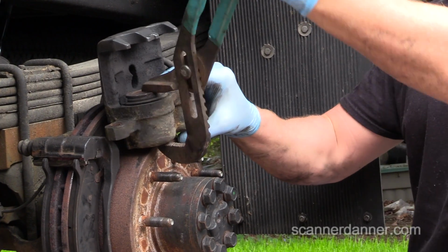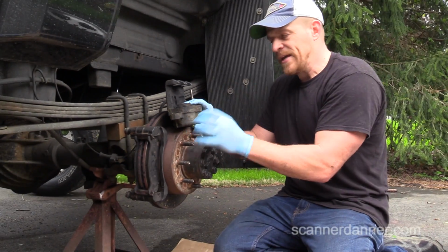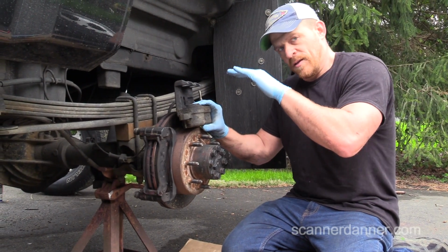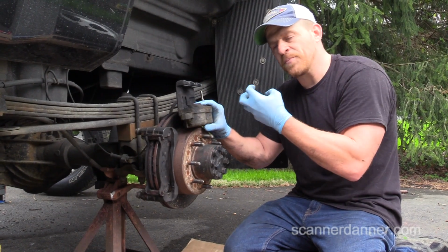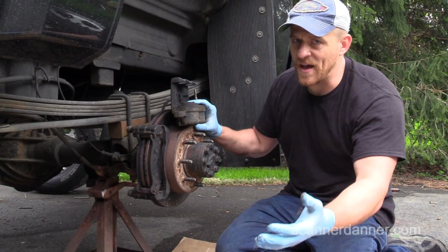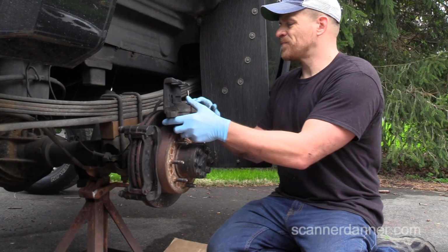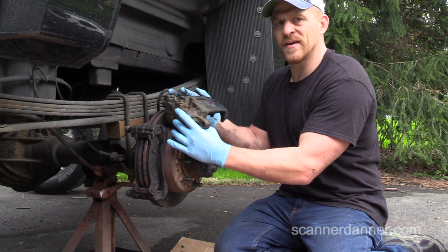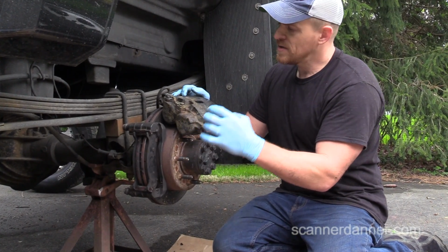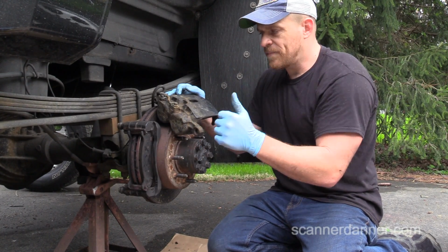The theory of that states that you have sediment and debris in here, and you're reverse flowing the hydraulics, and you're going to push that sediment into your hydraulics and your braking system. It's a valid argument. I'm with you. Here's the issue that I've seen. When rookies do that, they'll loosen the bleeder, compress the piston, brake fluid comes out, great, you're not pushing it up front. Cool, right? But here's the problem.